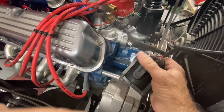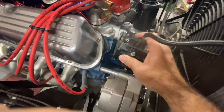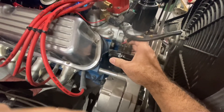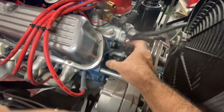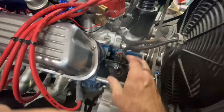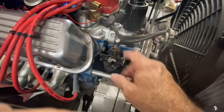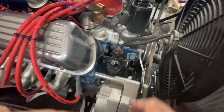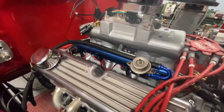For this coil, I think I'm going to try to pick up on the passenger side cylinder head — there are a couple of mounting bolts for accessories. I'm going to make some kind of steel bracket, maybe modify this one and pick those bolts up. I just have to make sure I position it where everything clears — the hoses, electrical connectors, and so forth.